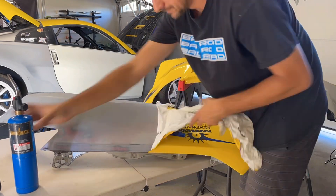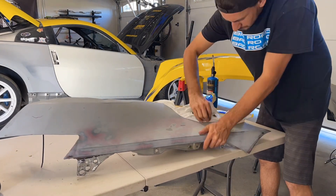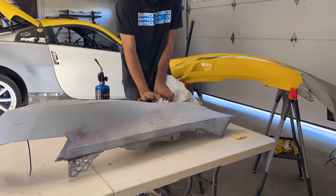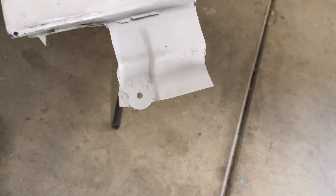Let's turn our attention to the fenders. Before I show you guys what I've got in store for these things, we have to take the wrap off — I'll throw you guys on a time lapse. Wrap is off the fenders. Check out this little trick: the bottom of the fender kept getting blown out at the 10mm bolt and coming detached. So I used a big fender washer, put a little weld around it, tacked it in there, and now we've got double the thickness and way bigger surface area. Definitely not going to tear that bolt out now.